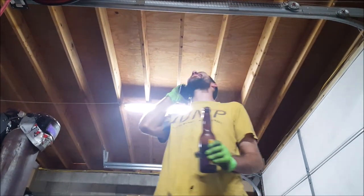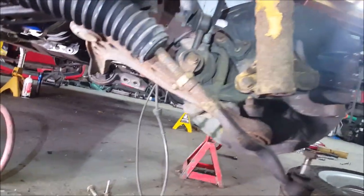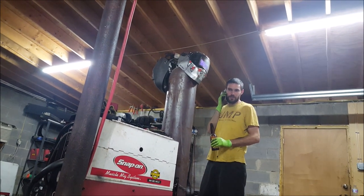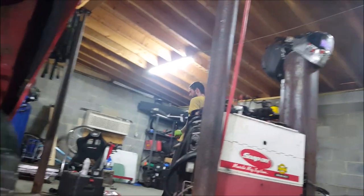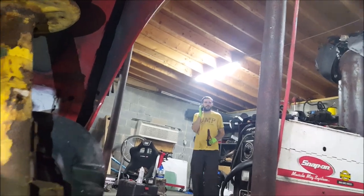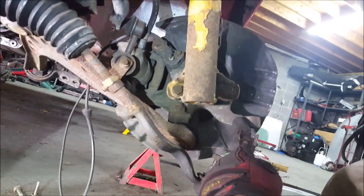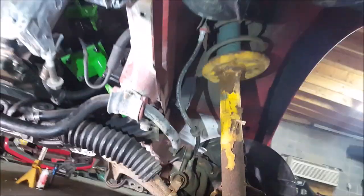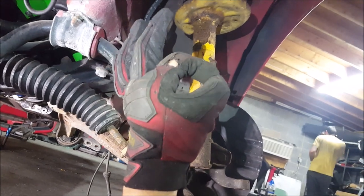So what we're currently doing — we're doing extended e36 arms. We're going to extend e36 arms and cut the knuckles, do the bushings, and do the shocks — all in one shebang. This thing's going to be a-okay.